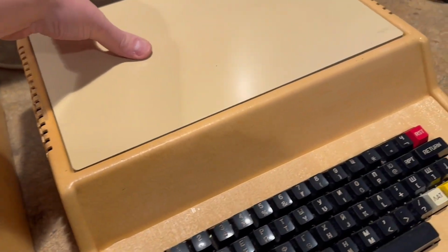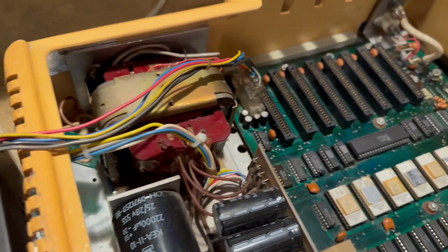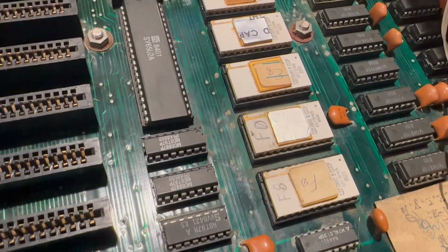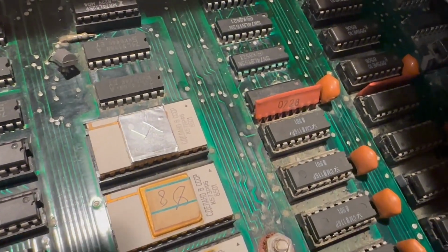We assumed it was just the power supply, which made no hum at all and tested bad, but we tried the other computer's known good power supply, and it still didn't power on, so there's definitely something up with the board. And the board has corrosion too, and probably deeper issues, so it may not be a simple fix and definitely requires taking out of the case, which we weren't feeling up to.